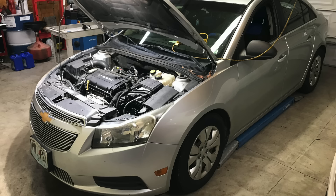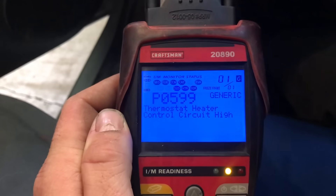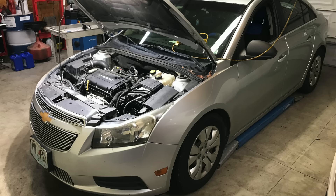The problem that causes the check engine light to illuminate with the P0599 code and the cooling fan to run at full speed is that the engine coolant thermostat heater encounters a problem. Generally you get a high circuit code, which means the thermostat heater is no longer functioning properly. Therefore it cannot control the thermostat via the powertrain control module.